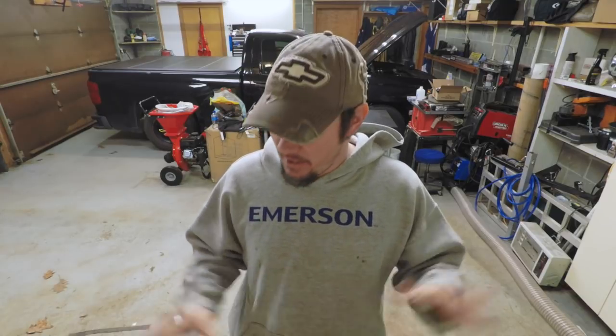So those are the big things. As I said, you want to make sure you have proper crimpers for your butt splices. You want to have a good test light. Other than that, you just need to know what you're looking for. So you need to know if we're looking for an always-on situation, a switched situation, an accessory-only situation, whether or not we need to add some switches or anything like that.